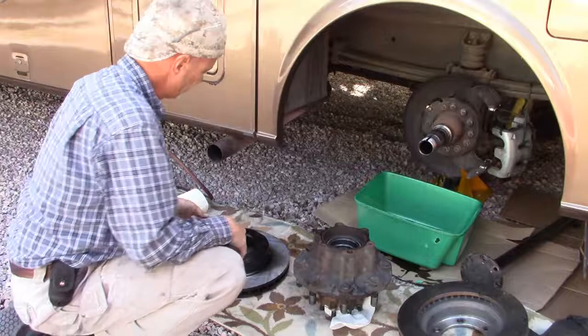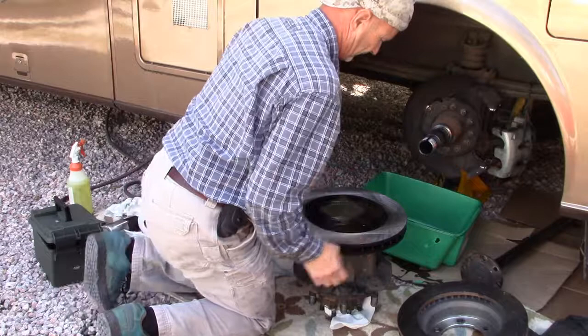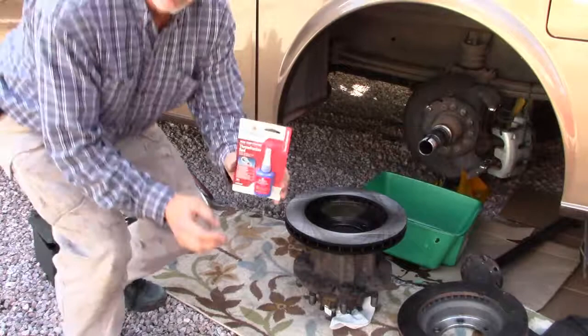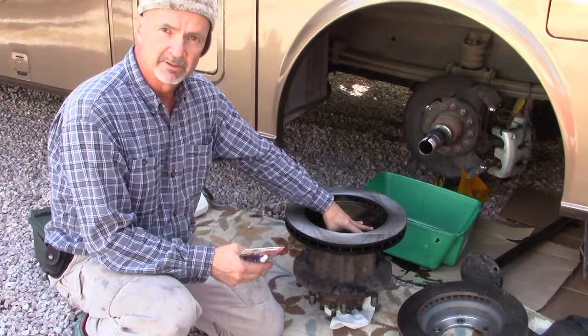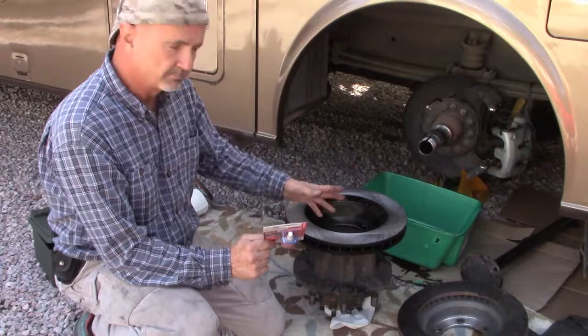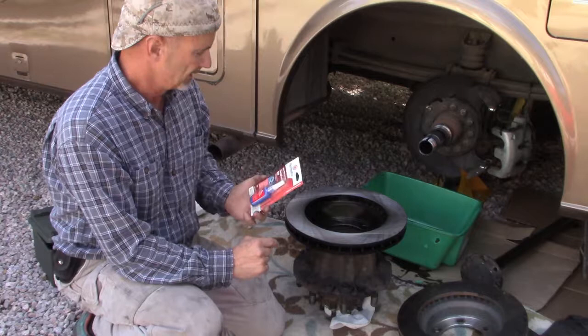So now I just gotta bolt this thing in place. As I bolt this disc on here, we're gonna apply some high temperature red thread locker on it. That should help, because you definitely don't want these coming loose. You don't even have access to them really if they were to come loose, and you wouldn't know it, and it'd just be a mess if it came apart. So high temperature because of the heat generated from the braking system, and red, so they're locked in there pretty good. Just use a small dab of it on each bolt, and then hammer them home with the air impact wrench.